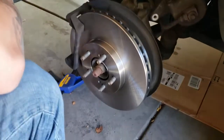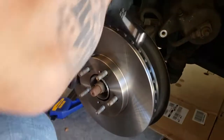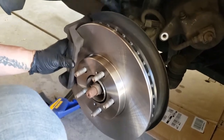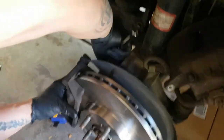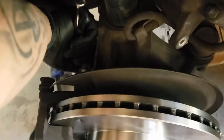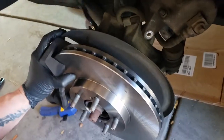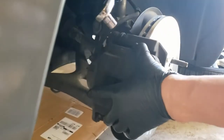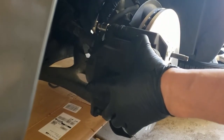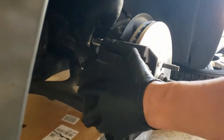We're putting this new rotor on here. The rotor's pretty easy — just line those up with the bolts there. Then you want to go ahead and secure the caliper. Get the big bolts in the back — it's a 16 millimeter back there for the big bolts. Get those in place, and then like the clamshell, you can put the top on after you slide in those brake pads. Once you've got the caliper bolts secure — 25 foot-pounds — you can go ahead and secure the caliper pins.